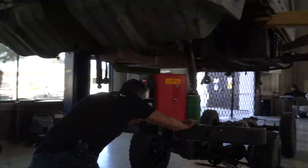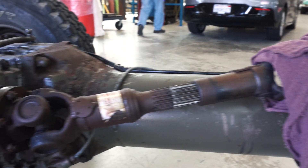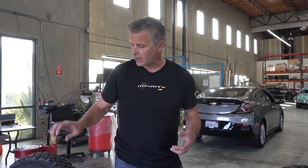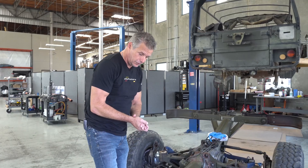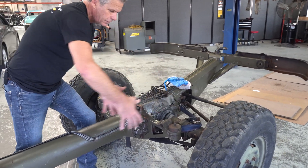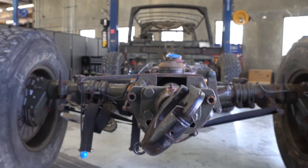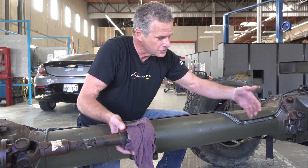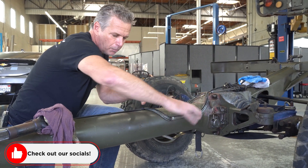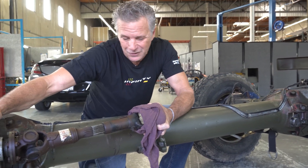Let me roll it out from underneath the vehicle. You have a massive torque tube that connects the front and rear transfer cases and the transaxles. There are two things you struggle with in an EV conversion: where to put the motor and how much fabrication work has to be done. The engine originally sat here, laid on its side — cylinder head under the driver's feet, crankshaft under the passenger seat, transmission right behind that into a driveshaft feeding into the drivetrain. The high and low range transfer is right here. The electric motor with a step-down will sit right in this space, using factory motor mounts, fitting right under the factory location where the transmission and engine sat. The OEM driveshaft into the transfer case will couple up right behind that — minimal fabrication required.